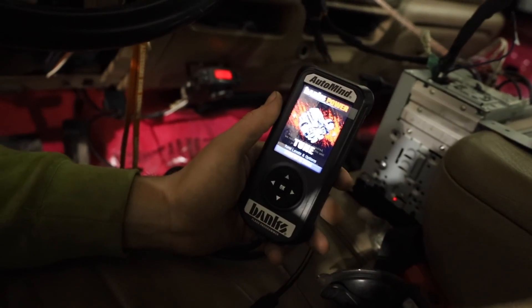It's on the performance tune. Honestly I think we're missing the fuel — this thing's got a quarter million miles on it and those in-tank filters, I guarantee, have never been changed. Even on the SCT all the ICP, IPR, and all those percentages and sensors are running perfectly. So the last thing is literally a fuel issue — either a weak fuel pump, clogged in-tank filters, or the fuel filter under the hood needs changed bad. New batteries should fire it right up, and a FASS will supply constant adequate pressure and separate air and water out of the system. I'll get one on order and throw it on next week.